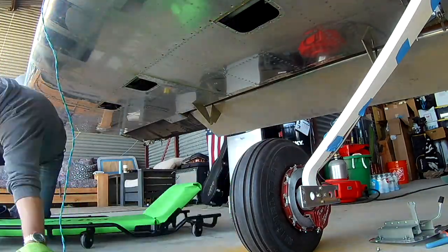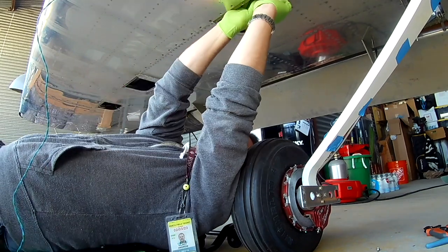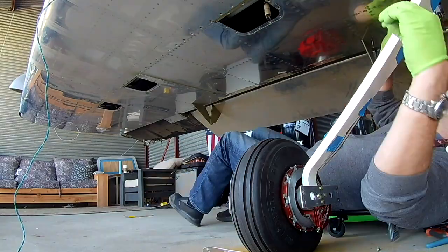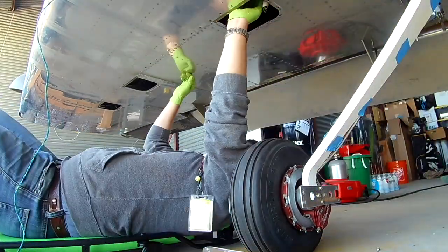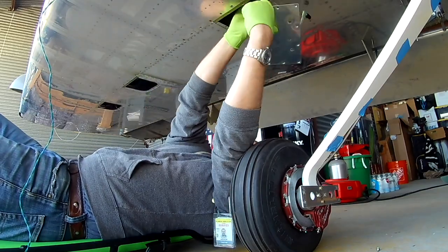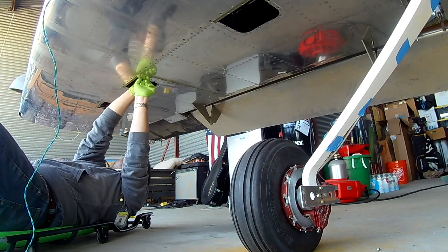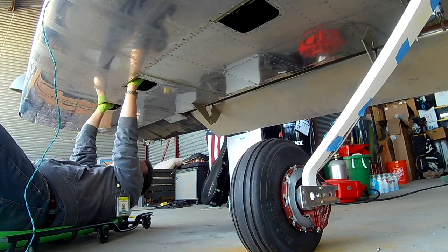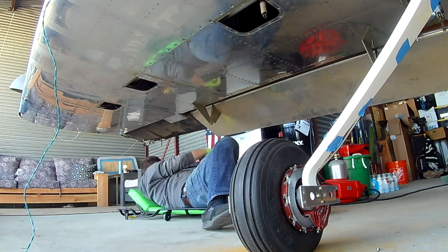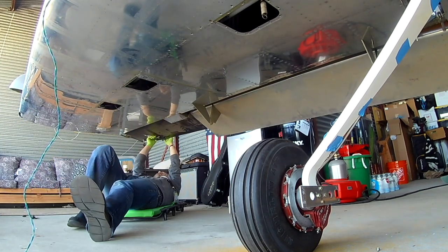Holy shit, that is just tough. I'm not gonna lie. You can see one of the springs there. Pulling one apart six inches with your hands doesn't seem like that big of a feat, but when you've got to attach two to that center arm of the aileron trim, it's not easy. But once it's done, it's great. Anyway, we're good there.